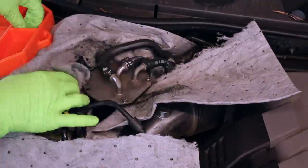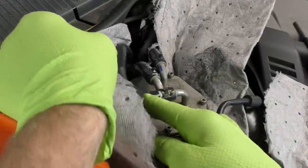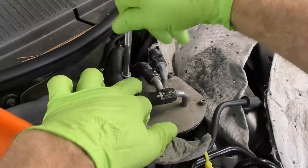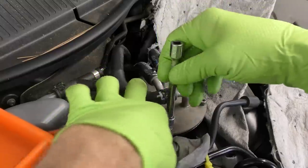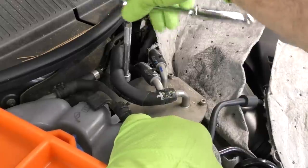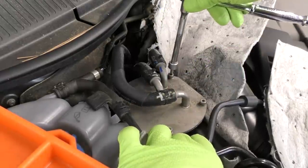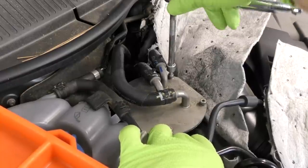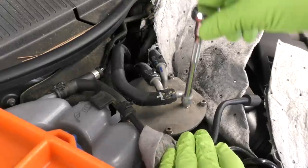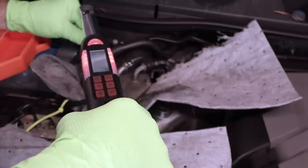Next we'll start our bolts by hand. Make sure if you're putting these absorbent mats down, you don't get any pinched in the filter housing — we don't want to cause any leaks. Then we want to just snug these down in a diagonal pattern, so go across — think about it like you're torquing a wheel down, same kind of thing. You can even push down on the filter housing a little bit to help. You don't want to tighten these down very tight. The torque spec is only five newton meters, which a lot of torque wrenches don't really even go that low. So if you don't have a torque wrench that goes down to five newton meters, snug them up but do not over-tighten this. You don't want to have to drill out and tap that housing or get a new one. I had to dig deep in the torque wrench drawer to find the one that went down to five newton meters, but that torque spec is just a little bit past my snug.